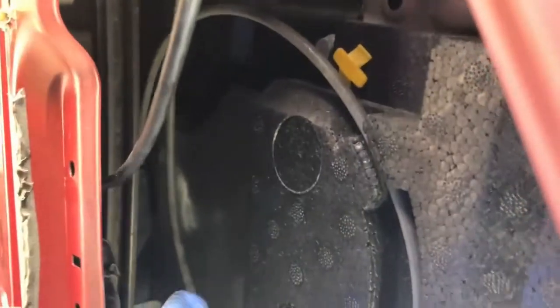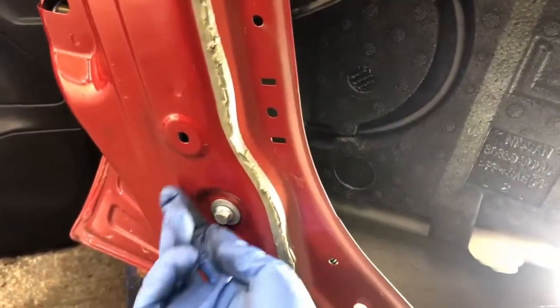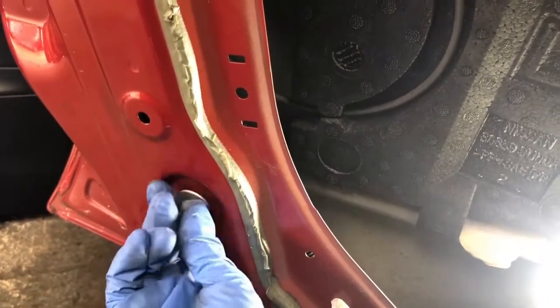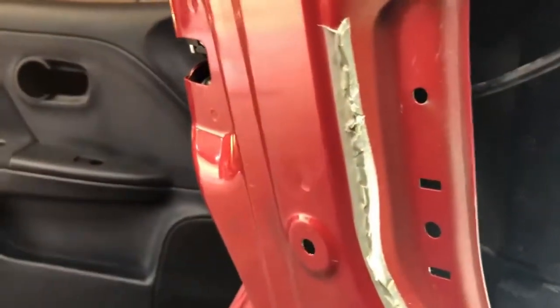And we have the electrical connection here, and then we have this handle, which is to be able to open it from the door. So I'm just going to disconnect a few things in here, and then we'll have a look at how it's done. Before I remove the actuator, I'm just going to release this 10mm bolt as well. This holds the window rail.